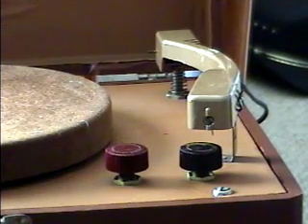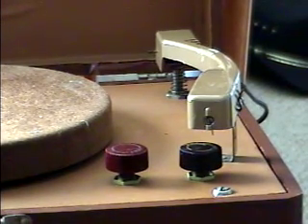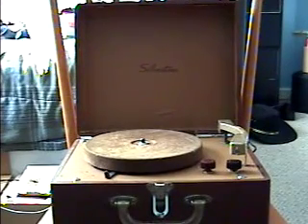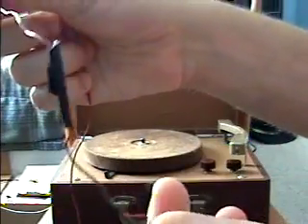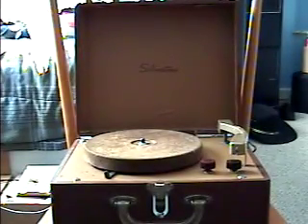I'm going to show you some problems here. Since this is a record player, it needs some repairs. I took the wirings out because it had old wires. The wiring originally came from the tone arm, but it snapped off completely. Somebody used red wiring. I need to get a new one and re-solder it — I'll need soldering tools to repair this. If not, I'll have to get another record player. The wires from the tone arm don't work properly.